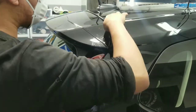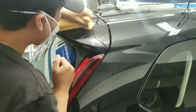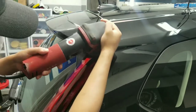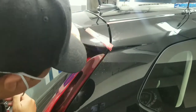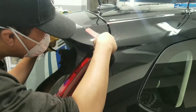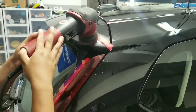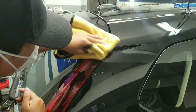Now I'm working on this weird splat of stain that's on the roof spoiler. From my initial inspection it's not bird droppings, it's not tree sap — it didn't come off with solvent. I tried hitting it with a Rupes wool pad and a compound and it maybe removed about 30% at most; it didn't even make much of an impact. I started to think it's some form of epoxy because it's really durable and it has a matte finish — no gloss whatsoever.